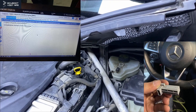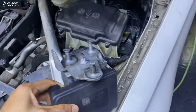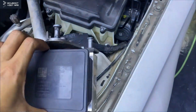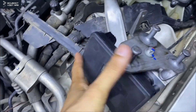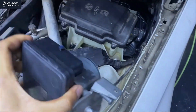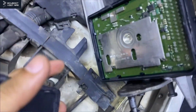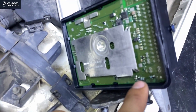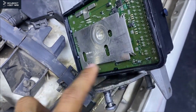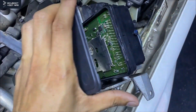It all came down to the ESP control unit. Here in my hand is the ESP unit from the vehicle — I've replaced it with another one, and later I'll show you how to replace it as well as the calibrations. When I opened up the original unit, there was a lot of water inside. I believe the rainwater flows from the windshield cowl and leads into the ESP unit.